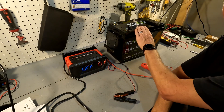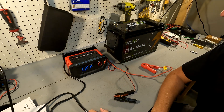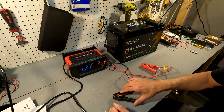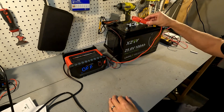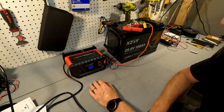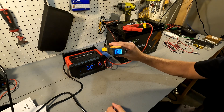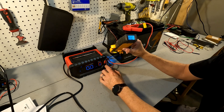I went ahead and switched out the 12-volt battery for a 24-volt battery. I just took the voltage of this battery and it's 26.6, so it could use a little bit of juice. Starting with the low setting, which says 3 amps, let's see what it actually charges at. It should recognize automatically that it's a 24-volt battery — and there we go, 24 volts. It showed 26.8 volts at 3 amps, and checking the amperage, it is charging at 3.1 amps. So the 3-amp setting is right on.